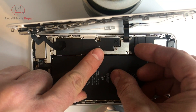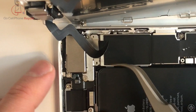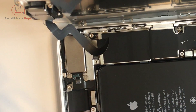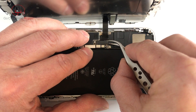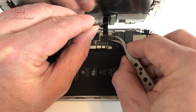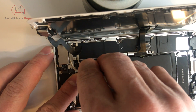After you get all the screws out go ahead and remove the cover plate from the battery and display connector, and also the one that goes behind the connector for the front facing camera. We have four connectors to disconnect — I recommend you do them in this order. Number one is for the battery and we want to get that unplugged first. From there we can unplug this cable, and if you lift it up you'll see that there is another one that is sort of obscured from view before you disconnect it, and then we want to unplug the cable for the front facing camera assembly.